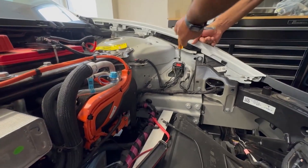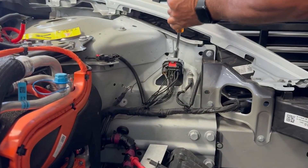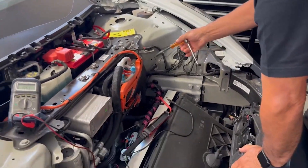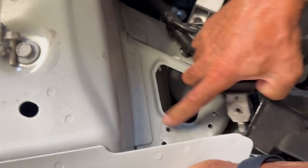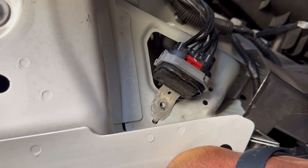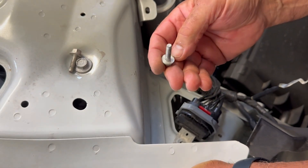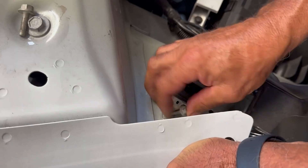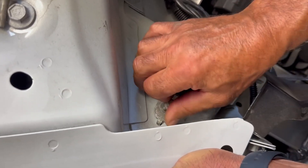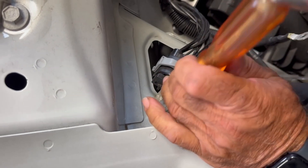It's probably a good idea to get a series of grounding washers and put them on every one of them, because they're all like that - there's paint underneath. What it really relies on is the thread of the bolt biting onto the head of the bolt, but there's not a lot of contact area there. So I would probably be inclined to put a special grounding washer underneath each one.